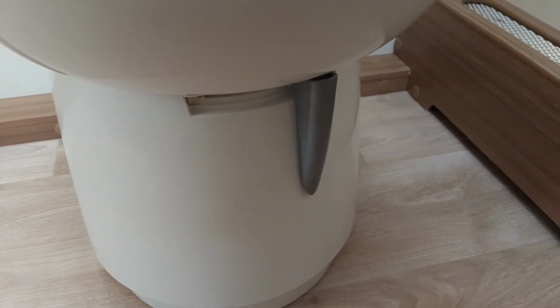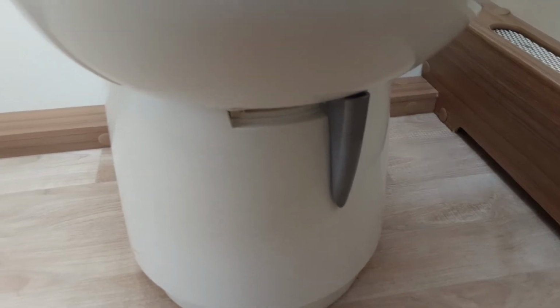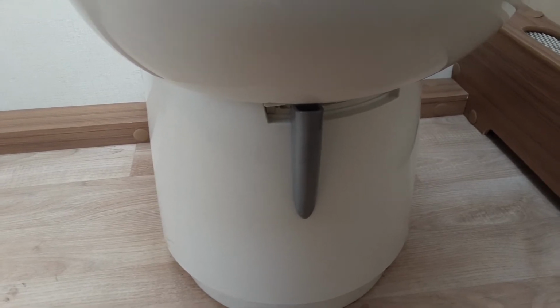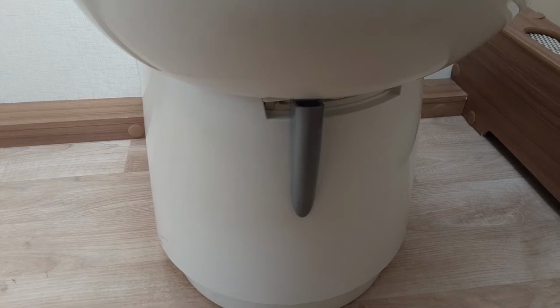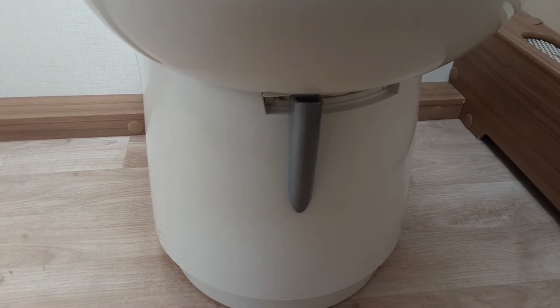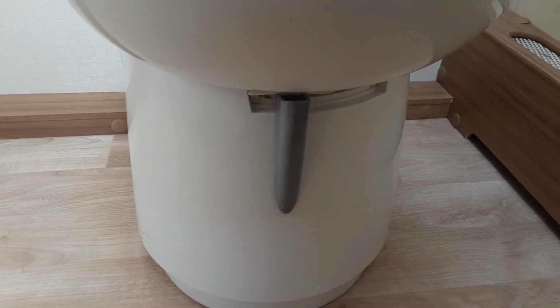To open up the grey waste handle will allow the toilet waste into the cassette under the van. We do advise you have it open when you start using the loo, and when you're not using the loo, have it in the closed position. One reason for this is it stops any smells coming up inside the van. The other reason is it allows you to remove the toilet waste cassette from underneath the caravan. If it's not in the central position, then you won't be able to remove it. And if you do manage to remove it, you could potentially damage the toilet waste cassette itself.